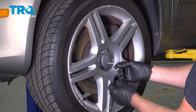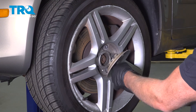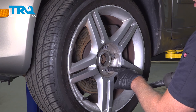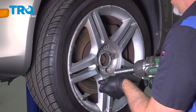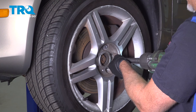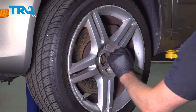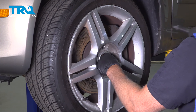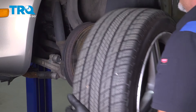Using the tool from the trunk, just put that in the hole in the center cap and you can pull the center cap out. Using a 17-millimeter socket, take the lug bolts off. Before I take the last one, I'm just going to hold the wheel on so it doesn't fall. Grab the wheel and slide it off.